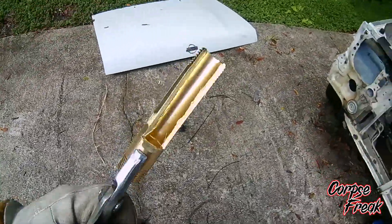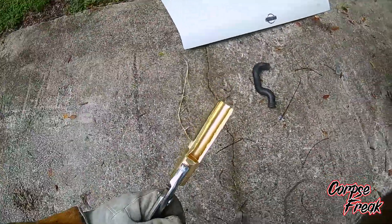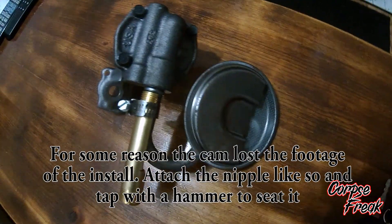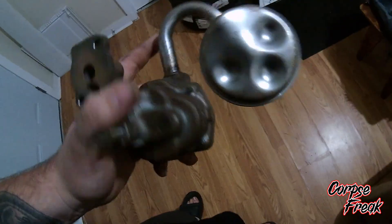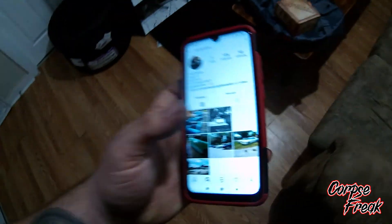I'm going to clean this up and then the next part will be actually installing the pickup on the oil pump. I got the oil pump welded in there — you have to do this with these style pickup tubes because under vibration they can rotate, which will mess with the depth, you'll have oil issues, and then you'll have a bad day. You have to get it TIG welded.